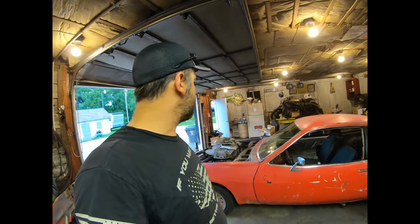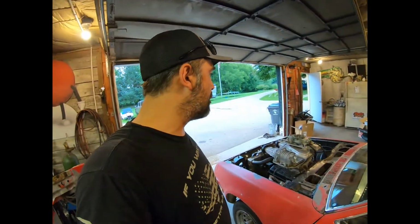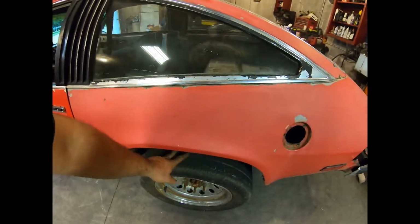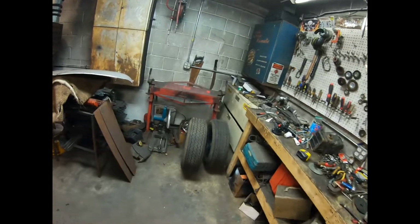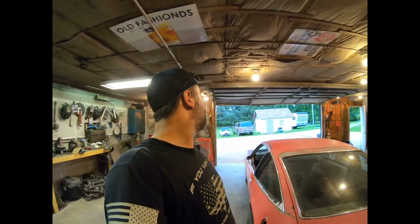So you know what? I'm gonna stop rambling now. Let's fire this thing up. I bought a brand new timing light because my timing light got wrecked along the line somewhere when we were setting this up. I'm gonna do a quick check on the timing on this thing, and we're gonna jump in this sucker, take another ride around the block. I'll show you what it's got now, and maybe we'll come back, and I kind of hate to blow the rest of these tires off. Like I said, they're almost gone and they're nice rollers for now. Maybe we'll shove these biases back on and light it up for 40, 50 seconds, and I'd hate to put it in a lean condition on purpose, but maybe we'll do it and see how long it takes for that carb to run out of fuel again.